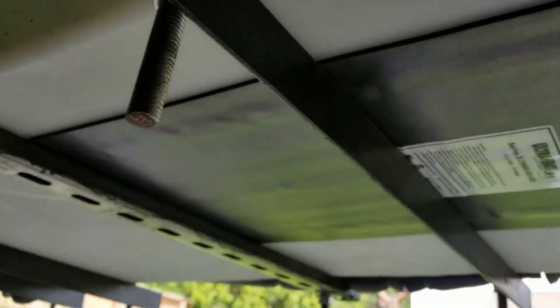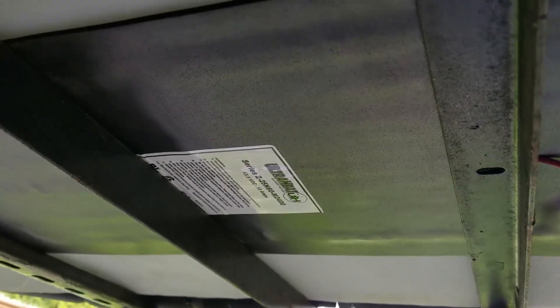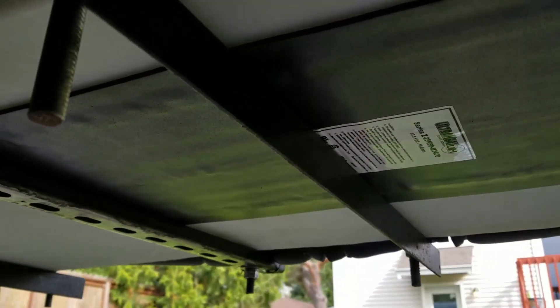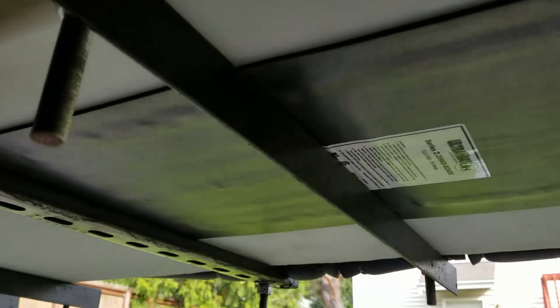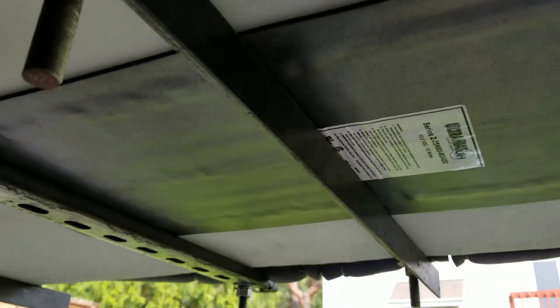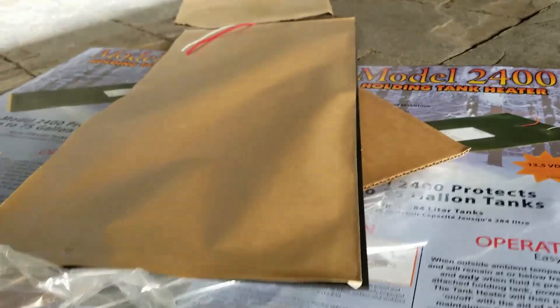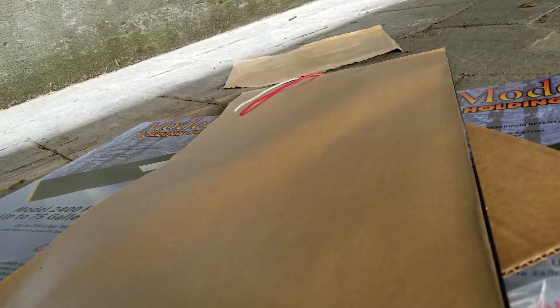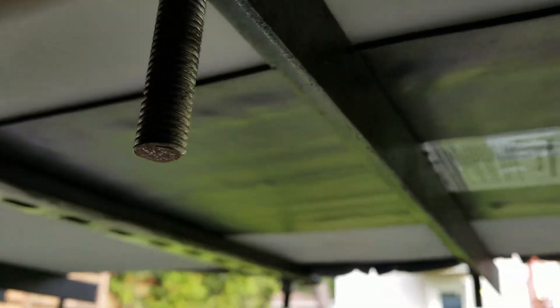The first pad is on the freshwater tank and it is all clamped up. I had to put it on, then realized I left some of the tape — the paper — on, had to undo it, pull it down, pull all that tape off, and re-adhere it to the tank. It was pretty forgiving for having to do that, but you don't want to have to go through that. Make sure you get all the paper off the first time. What I had done is ripped off the tape, but there's another piece of paper there that needs to be ripped off with more adhesive under it — that's what needs to be flush against the tank. But it seems to be holding pretty well, and most of the stress seems to be on the corners, so I think this will be okay.